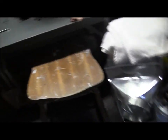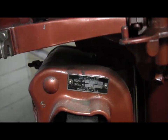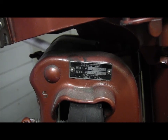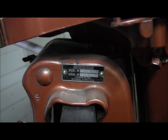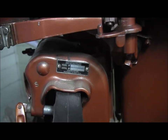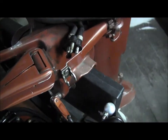Each one of these little motors has a unique VIN number and it's located on the transom clamp — it's riveted on there. It gives you the manufacturer, the model, and below it is the serial number. John, I know in the video you said you thought the thing had been painted with house paint. If you take a little stripper, you can clean the plate off — the numbers are stamped so you won't wash them off.